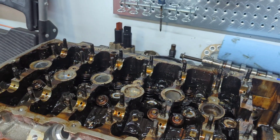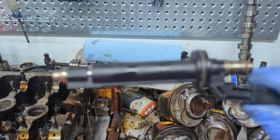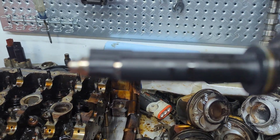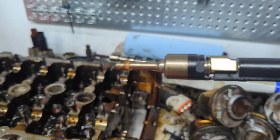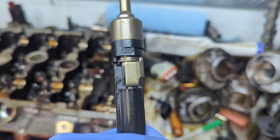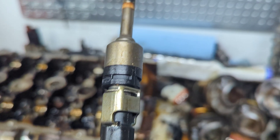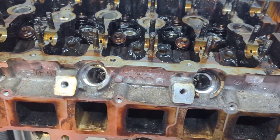This is a short FSI injector. This is what happens when you pull it out — you'll notice that the C-clip, or the clip that holds the two halves together, didn't go with it. I looked online and couldn't find any video about this, so this is going to be me attempting to show you. This clip right here in the middle — the little silver shiny clip — just pulls right out. And you'll see there's a little ring that slides into the seat of that clip to hold the short part with the long part. But I used the official tool and it still came out with the clip stuck inside the head. So this is going to be how you get that clip out of the head.